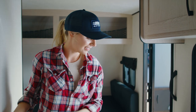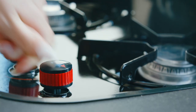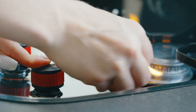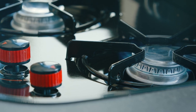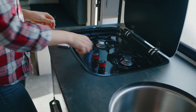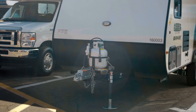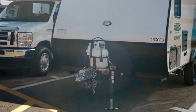This stove works on propane. There are two burners with two knobs. To ignite, press and hold down the knob on the light position. Use a match or lighter. Make sure to keep the knob pressed down for at least 10 seconds after you see a flame, then release and adjust the intensity as you desire. Pro tip: if your stove is not igniting, check your propane tank outside — you might have turned the valve off.